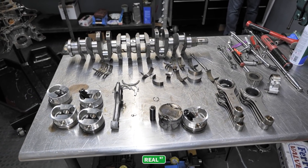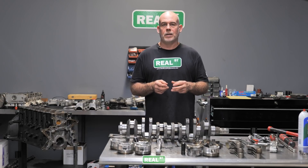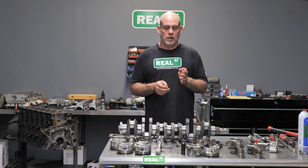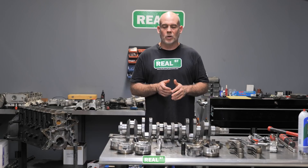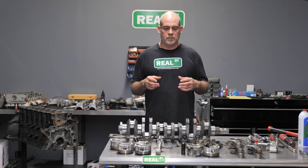I hope you guys enjoyed this dissection. It's kind of a mixed set of emotions for me because I just hate to see an engine die like this. When you lose fuel pressure the way that it did — isolated at one injector — you're going to have limited fuel flow at that injector. It torched that piston out, blew aluminum down onto the connecting rod, onto the bore, the crankshaft, and the main web — just kind of a horrific death. The cylinder head is junk. The damage on the ends of the head gasket — I'd say with a factory head gasket, this amount of time and boost, we're going to move to a fire ring setup.